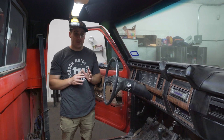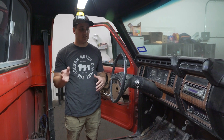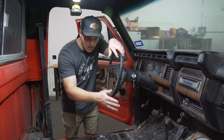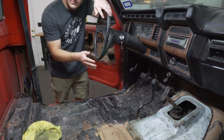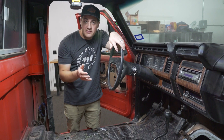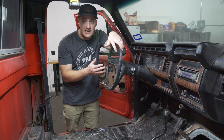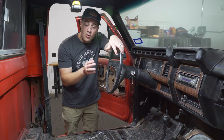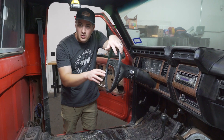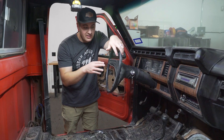Inside the truck you can see it's been torn apart — whole interior out, carpet out — we're going to do fresh carpet, clean up the seats, and do a ton of work in here. What I want to focus on is what we've spent most of our time on before this video: our ZF5 manual transmission swap and putting in our transfer case. This all came out of a '95 F350 with a 7.3 diesel, which is an almost direct bolt-up for the 6.9 IDI we have. Our ZF5 swap is done, the transfer case is in, and we cut the hole in our floor for the transfer case shifter.